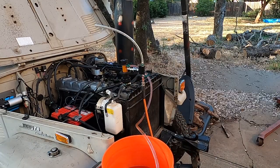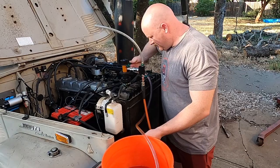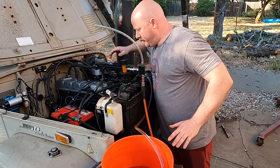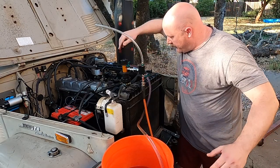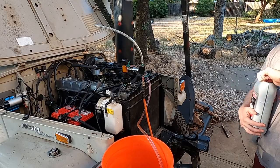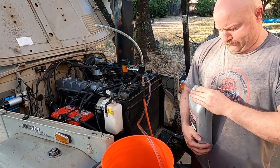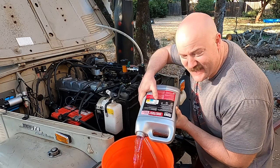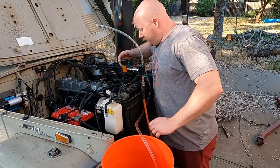I don't even know if the water's going down — I'm gonna mark it. This is stressful. Maybe it's not flowing? There we go. I think I had the knob in the wrong direction. Now it's definitely flowing. I'm putting more coolant in here; it's going down really fast — not faster than I thought it would be. This is all to keep air bubbles out of the system. There's definitely antifreeze in my drink now; I don't think it's a killable amount. It's using the vacuum to refill everything.